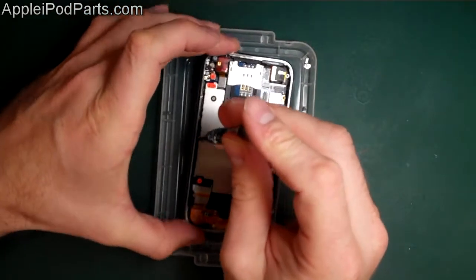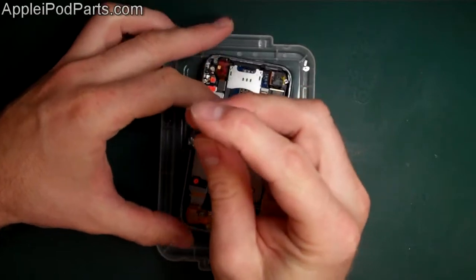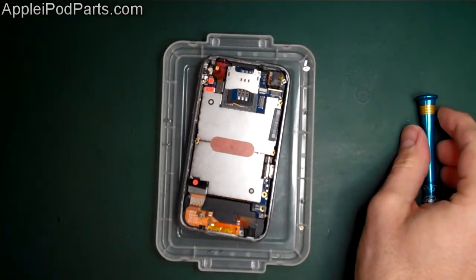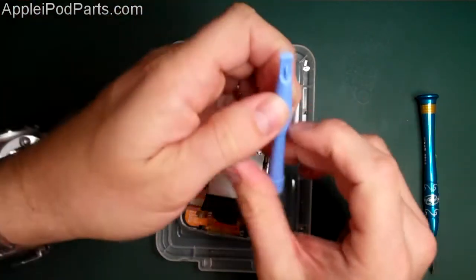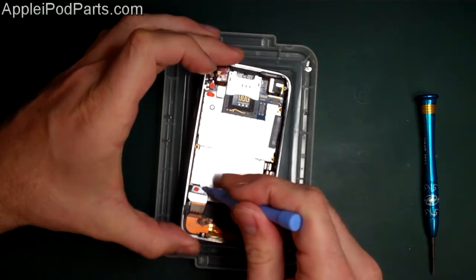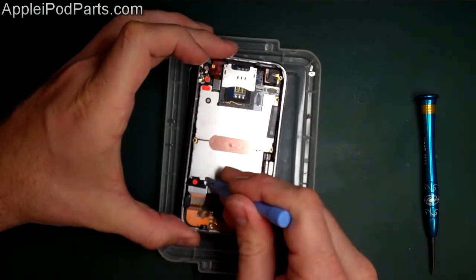The screw mid-board here - I'll try and do it so you can see it. And then finally there's a screw underneath that cable. So we can start popping off and remove the little ribbon cables internally now. Number four needs to come off - we can get in either side, all the way around the connector, it just pings off. Be careful of any chips underneath it.